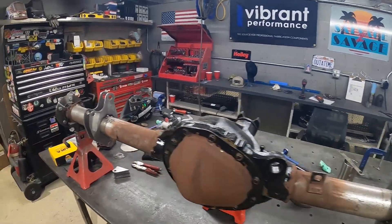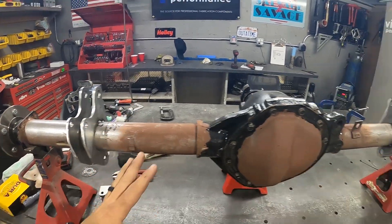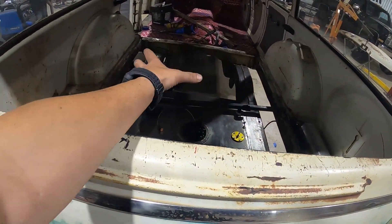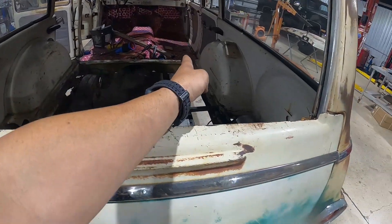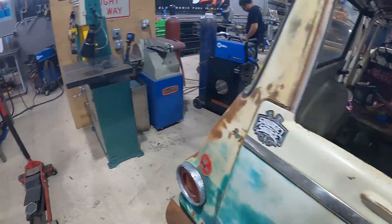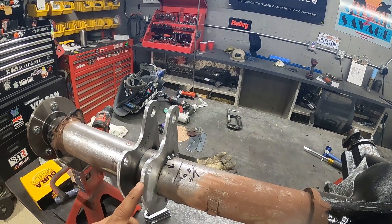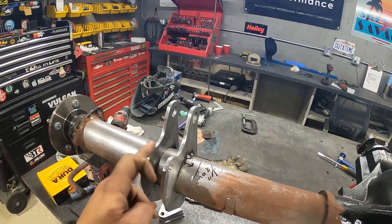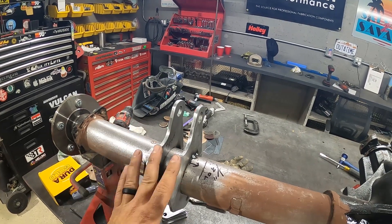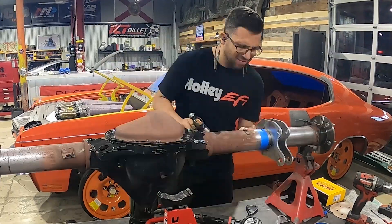We got the axle on the bench for final weld up on the shackles. The driver's side was off by a half-inch — after a bunch of measurements we discovered the actual frame rail is shifted over a half-inch. So our four-link on one side was nice and square while the other side was kicked out. We marked the axle tube a half-inch over, cleaned everything up, cut the brackets loose, bolted them back with the correct spacing, shifted them over a half-inch, tacked them up, and did a final weld. That should fix the issue.